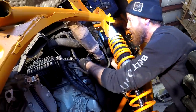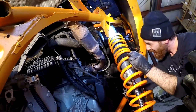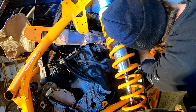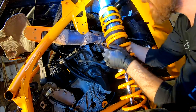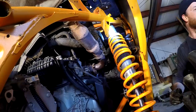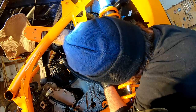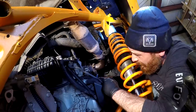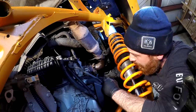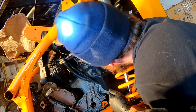There we go — one bad bad boy. I'll let that dangle right there. Out you go. At this point I think I've got to get that access plate off, get a deep socket on there and loosen that V-band. There's a gasket here that we've got to reuse.